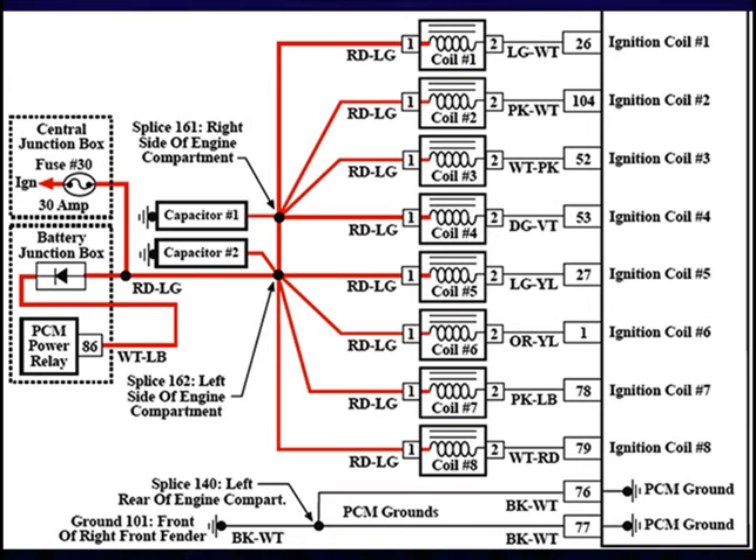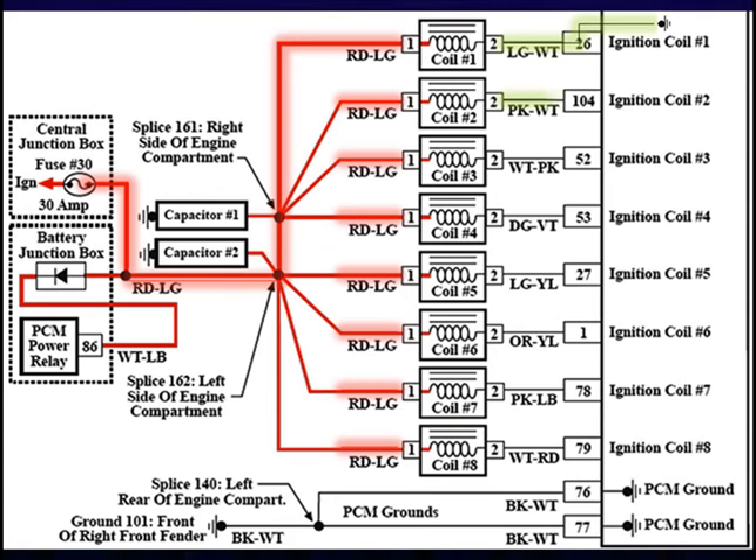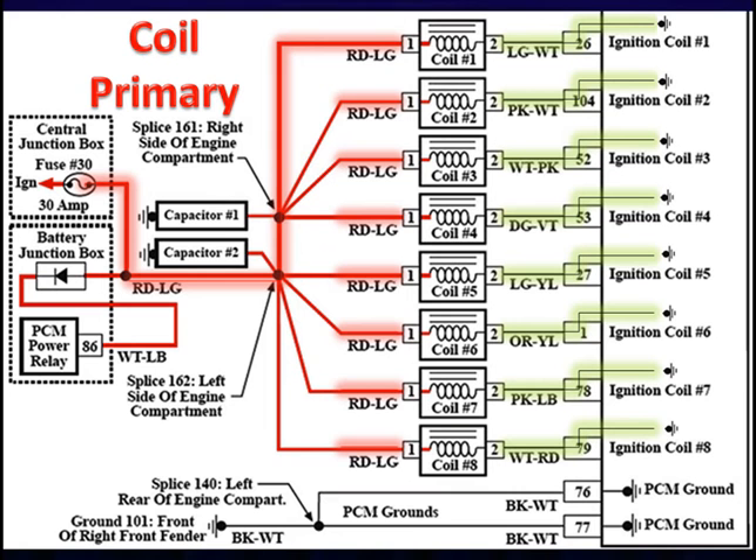Back to review. Here's an example of a coil-on-plug system where B-plus comes in from the fuses and goes to all the different coils. We can test B-plus here. We also have to be able to supply ground. In this case, it's a two-wire coil-on-plug — the computer supplies the ground. There are variations: two-wire, and three- and four-wire. Three- and four-wire use a control signal, and the module itself, the coil-on-plug, supplies the ground. In the two-wire case, the PCM has to supply the ground, meaning current must travel all the way from battery negative, through the PCM, through the coil, back to B-plus for full current flow.